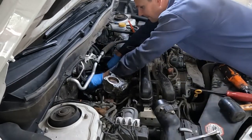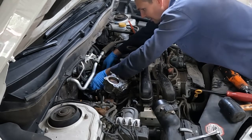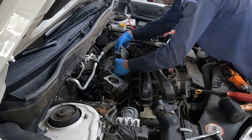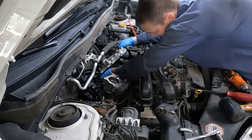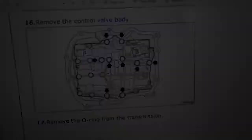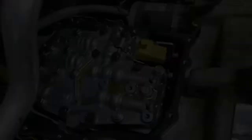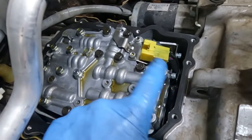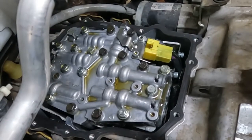Let's see if that is enough to come up. There we go. I'm going to pull this up in this direction. There's a connector inside. Here's the valve body on the transmission — so it's these two here, this whole string, and then these two, and the whole valve body comes out. Those are 10 millimeter.